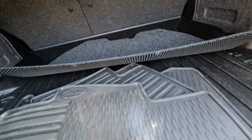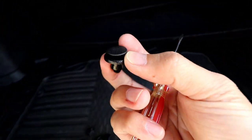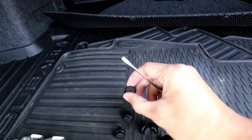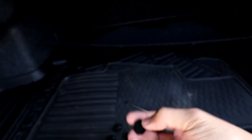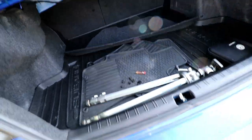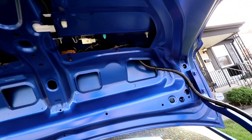All you need to do is pop the trunk. You're going to have a liner up here — looks just like this. It's held in by eight clips, and these are just a push-pin style. All you'll need is a flathead screwdriver, and what you'll do is pry up the center cap. They have lips on the sides so you're able to pry it up very easily. You just pry them up and then they'll pull right out. You have eight of those. Once you get that all unbuttoned, you remove the liner and stow it away in the trunk or out of your way, and then you get the trunk exposed.